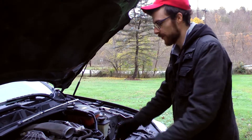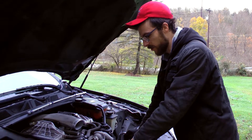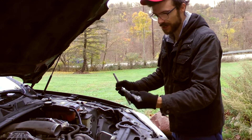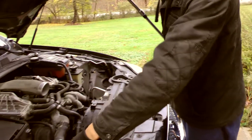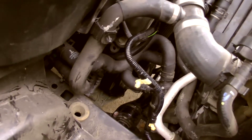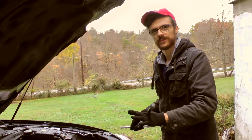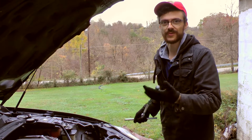We keep moving on. Now we know what to do, what not to do, where to go. We're gonna put that back and move on to some hopefully simpler things. Let me show you what I did for getting that pulley loose. This is my setup — I know it's really janky. I have a little duct tape on the tip for grip. I moved the air box and you can see the pulley all the way down there. It just has a little grip on the rubber, so it's able to push it just about an inch — enough to loosen up the belt. Be careful when you do that; it's not recommended. It might slip or damage something, but we didn't. My foot was on the wall pushing — that's how much force we needed.